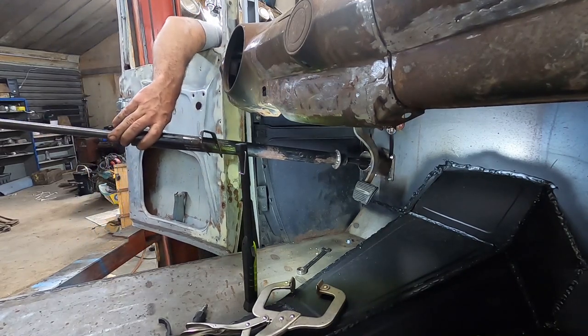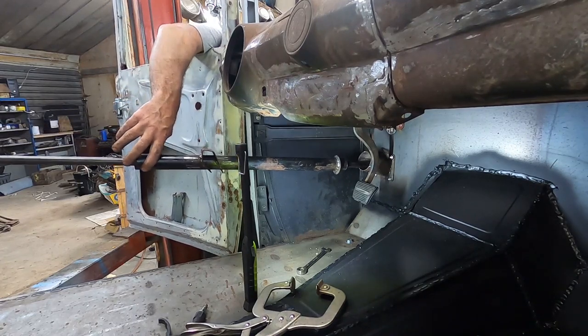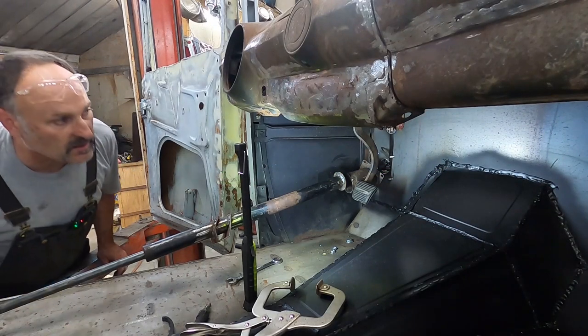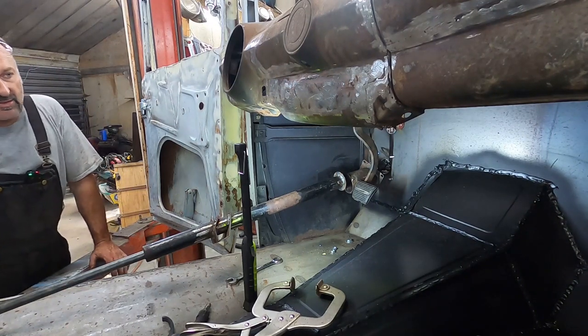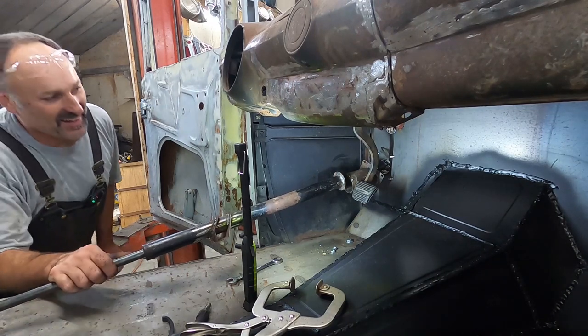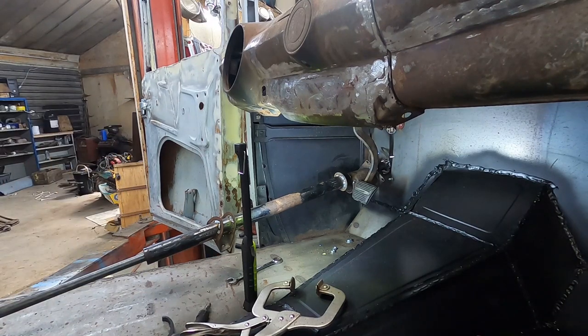Bugger, just what I thought. There just wasn't going to be enough room on there. You might have to enlarge our hole a wee bit. Alrighty, so we made a big mess so far. This is not in far enough and it doesn't want to go in far enough. The shaft just seems to be a hair too big. So I guess I'm just going to undo my steering box so we can get that wobble joint off.